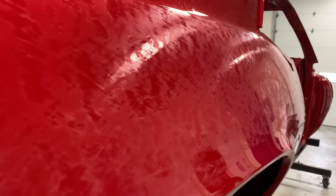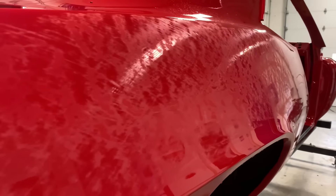This looked very good looking down the panel. But as clear dries and as paint systems dry, naturally they shrink, and that's where you get this peel from most of the time. This was not this peely when we sprayed it — that's why we let this dry, let it shrink, let it do what it wants to do before we cut and buff. After only a few swipes with the linear, it maps out every little bit of peel, big and small.